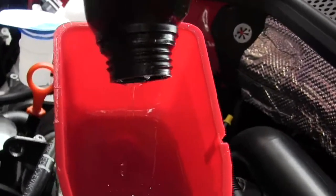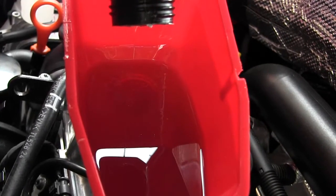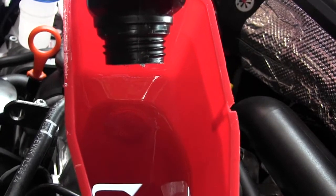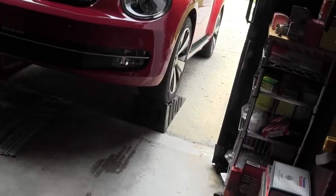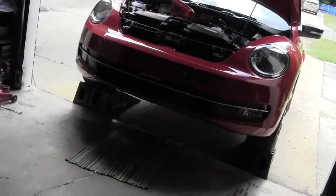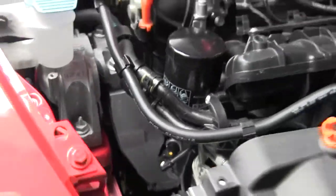I actually don't need to show you how to do all five quarts, but I can show you a couple. Once it's done, you want to drive the car and bring it back and put it on a flat surface to check the oil and to check underneath for leaks. If you see that the ground has a leak, this garage has a lip on the way in — you don't need the rhino ramps. Once you start coming in, you see how it points upwards and you can get underneath it enough to see if there's any leaks. You can also check from above for the oil filter — just look around the area and look to see if you see any oil. If there's oil later on, then you know you've got a leak.